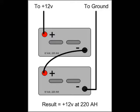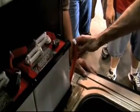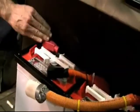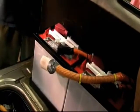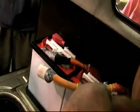Now let's talk about the batteries. You can think of it as one long string of batteries. This is the start — the most negative end. Each battery is 6 volts, so as you measure across each successive battery, it's 12 volts, then 18, and so on. This link here connects the rear battery bank to the forward battery bank — positive to negative. You continue adding batteries until you reach the most positive terminal, at which point you have roughly 144 volts.